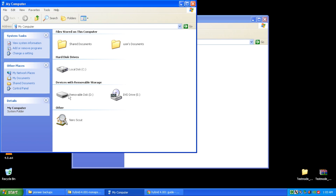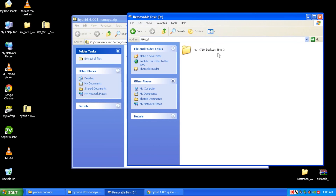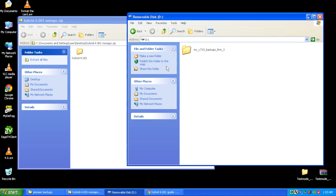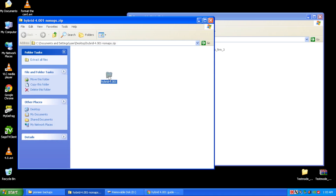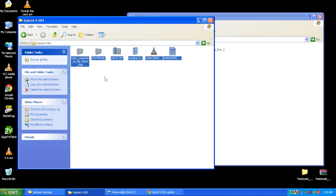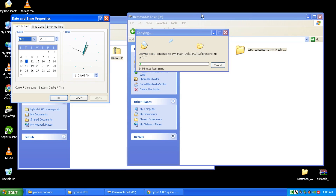The SD card on this particular machine is the D drive. Now I still have the backup of my 3.0 firmware, and that includes the maps. This is important because this upgrade does not contain any maps, so we will need maps after we do this firmware update because we're basically formatting the drive. So next we're going to open that up, select all with Ctrl+A, and drag that to the SD card. It's probably going to take about five minutes or so.